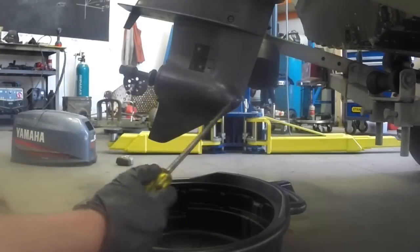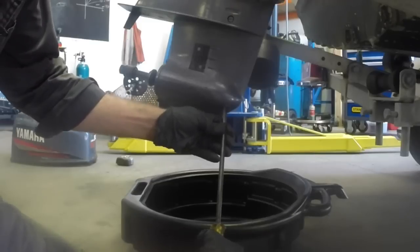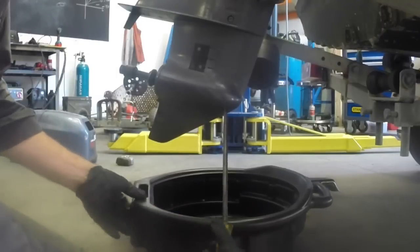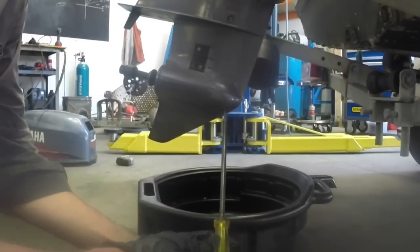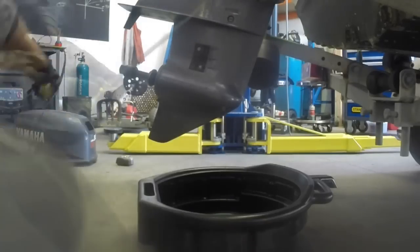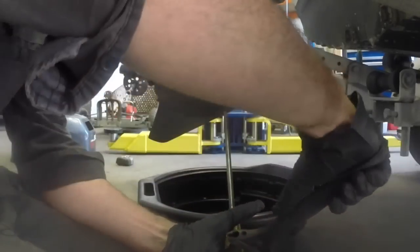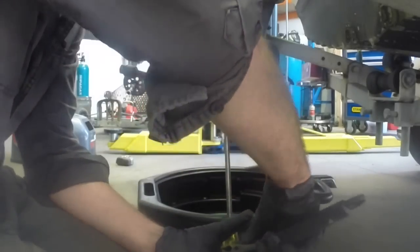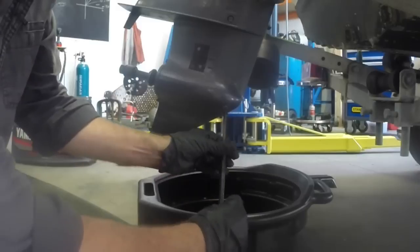Next thing I'm going to do is drain the gearbox oil. Those of you who subscribe to the channel will have seen this a few times in the past, so I won't agonise over this. Now this drain plug's pretty tight, so I'm just going to grab a shifter and put it on the end of a screwdriver. Quite often you'll need to do this if these have been done up too hard. So I'm just going to use one hand to hold the screwdriver in, and the other to bring the shifter around until it's cracked.